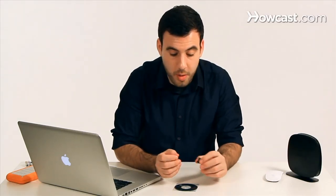If you don't have the CD, you can always download the drivers from the manufacturer's website. For example, if it's a Linksys wireless adapter, I always like going to support.Linksys.com, and so on with every other company. They always have a support website that you can download everything from. Just make sure you have the right model number — don't just download any driver. You want to make sure you've got the right model number and the right operating system for your computer, and then you should be good to go.